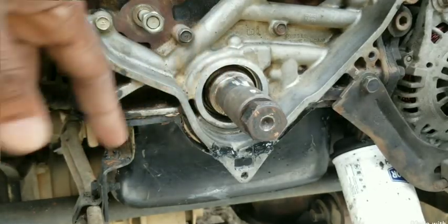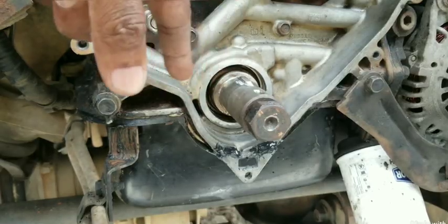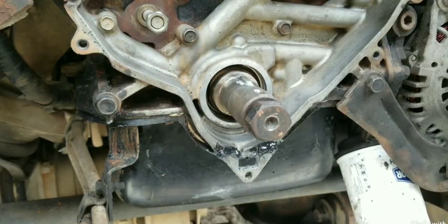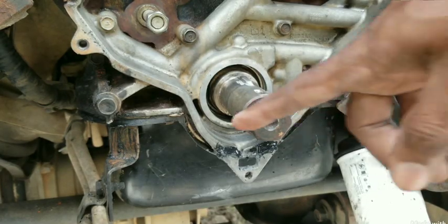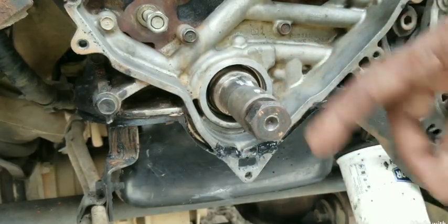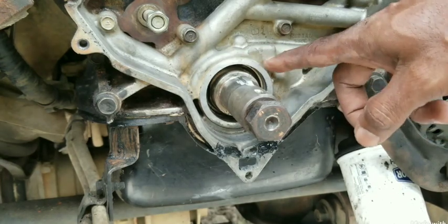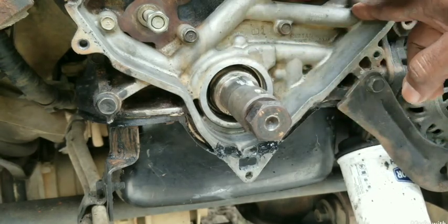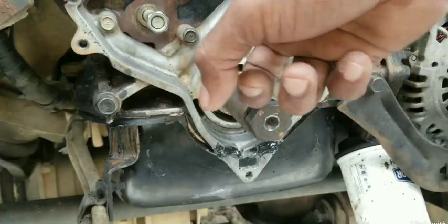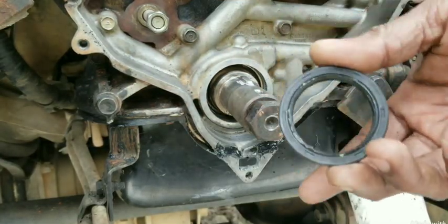So Buick and Honda introduced this pump, which is mounted on the front of the crankshaft. The crankshaft drives this pump — it has a rotor on the inside and a ring on the outside for producing oil pressure. That oil pressure comes up from one side, gets pressurized here, then sends to the filter and goes back into the engine block.